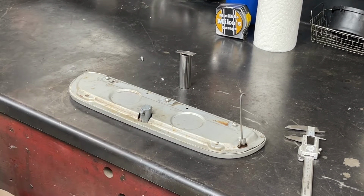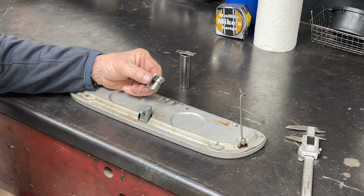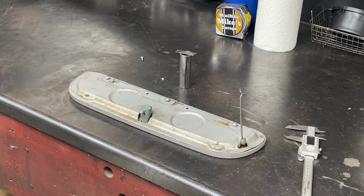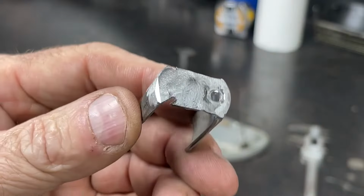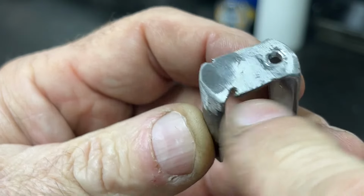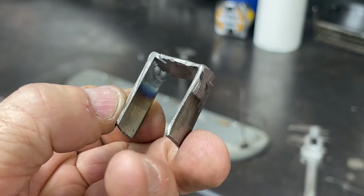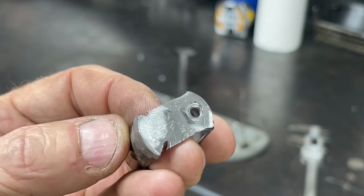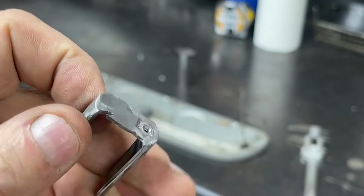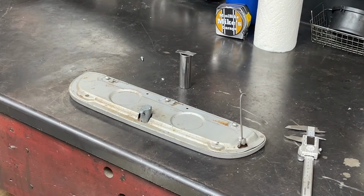And I went ahead and already have got it made up. And this is the piece. This is what it looks like. Now this one's kind of ugly, but it works. So I got a little overzealous in my cutting out my side, but that's not a big deal. So you can see I just took that flat stock, welded it across that round tube, and then just kind of set it on there and eyeballed for that hole, marked it, and drilled that out.